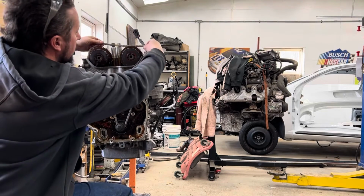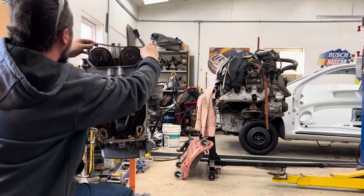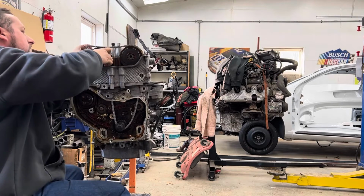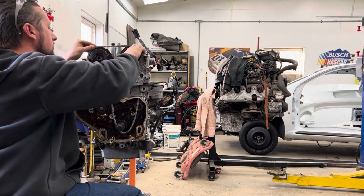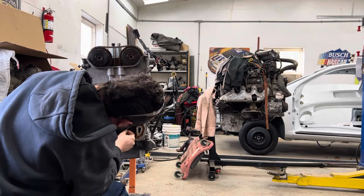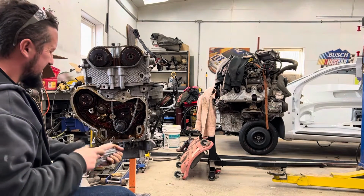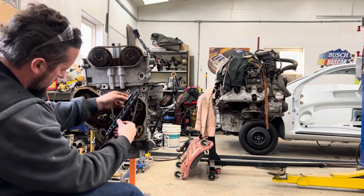Where'd my colored links go? Going this way, right? So the gold colored link I'm going to put on the diamond. The other link is going to go on the triangle, like so. So the gold link is on the diamond. The dark link is on the triangle. This dark link is pretty close to this dot down here. If I pull it tight, right about there. All right, so now in this kit, you'll have the new tensioner, the black one that goes on this side. So you've got to fish that bad boy up in there like this.